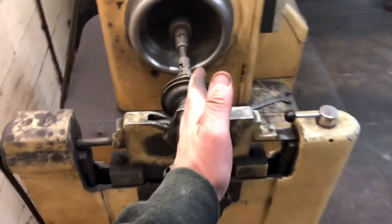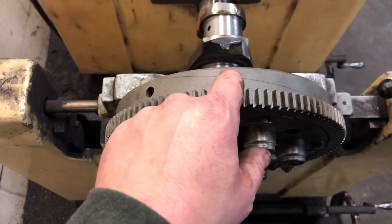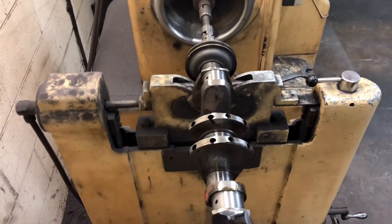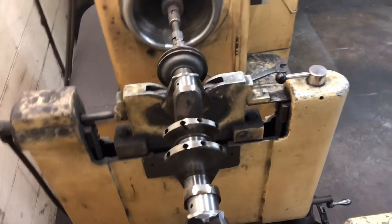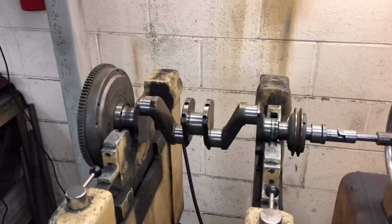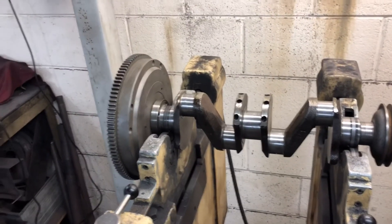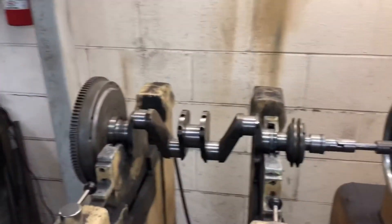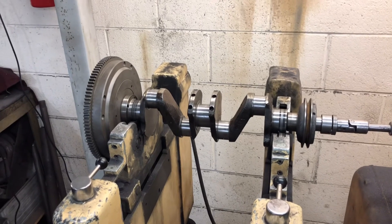What I normally do now is put it on TDC - number one at the top - with stamps and marks here in the flywheel and here in the clutch. The front pulley is keyed anyway so that can only go one way. Then the customer will know where to put this clutch and flywheel when they fit it on the engine. So there we go ladies and gentlemen, that is how we balance crank assemblies. As you can see by the amounts we were looking at, it's very important to do this. All of our engines have every component balanced - makes a hell of a difference. Thanks a lot for watching, remember to subscribe and hit that notification bell.